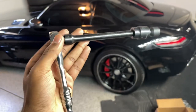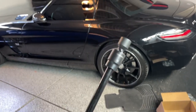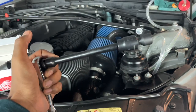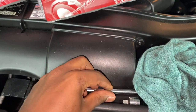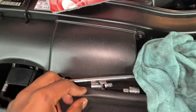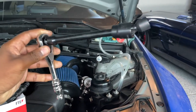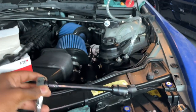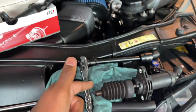Using a 100-count ratchet — you can see over here — I bought this at Home Depot. It's a little stubby three-eighth inch drive ratchet with a three-inch extension, six inches total, along with a wobble socket. It's a 13 millimeter. I think this is the only way you're going to be able to get access to the top nut of the slave cylinder. I tried a variety of extensions with swivel joints, quarter inch stuff, even my Milwaukee electric ratchet — nothing would budge. If you have these tools, this should work. Prepare yourself.